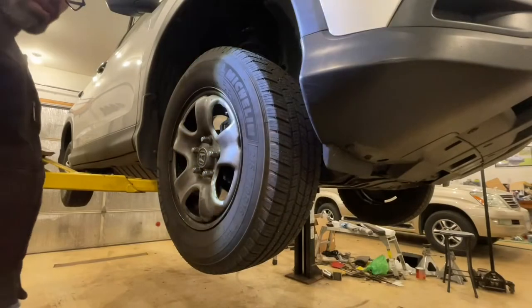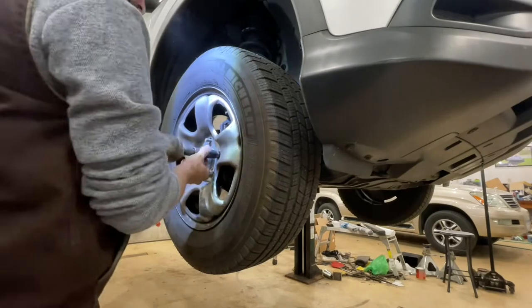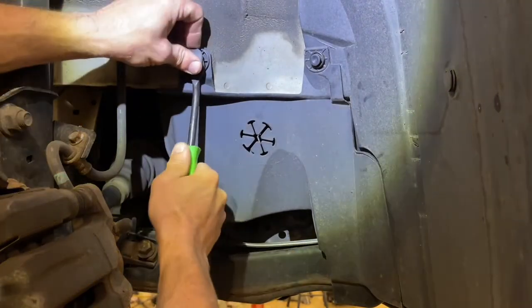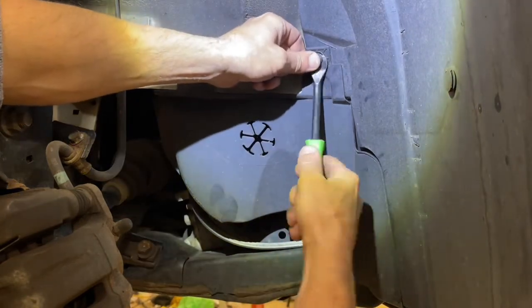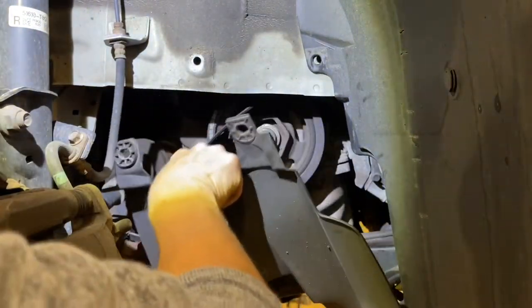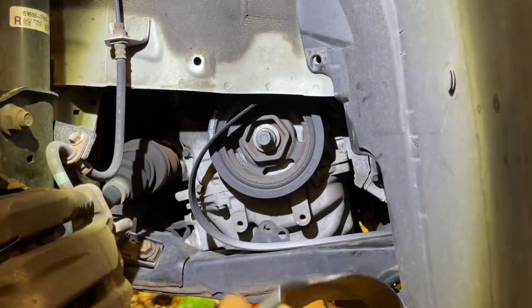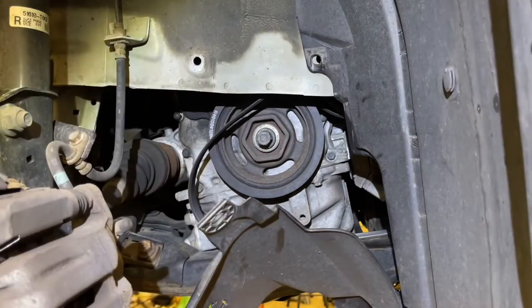Now I'm going to lift this thing up and we're going to go underneath. The next thing is to take the wheel off. We've got a couple different fasteners in here — it looks like something probably broke at some point, so there's a mix of original and non-original fasteners. We should be able to swing this cover down out of the way enough — it kind of wraps around and goes all over the place, so we're going to do our best not to fully remove it. That now gets us access, and you can see the serpentine belt is already kind of falling off in there.